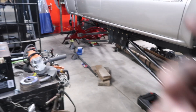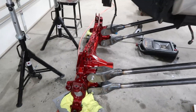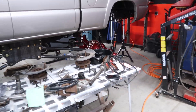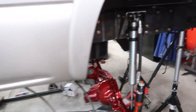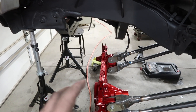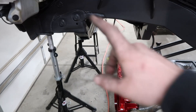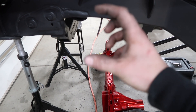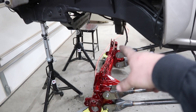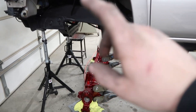We might need to order some stuff, but we have both axles under the truck, bolted on — not fully, but we're going to jack this up now and get it set, centered on both of them, so we can take proper measurements. I still have to make a crossmember that comes across here. The reason we need to get the front in is because we need to know our steering before we can set the rest of it to eliminate bump steer. Basically we're going to make our drag link from our pitman arm to our knuckle, and once we find the length and degree of that bar, we can then make our panhard bar to match. You don't need to do it for the rear, but I'm trying to make it all look perfect. Once we have our front panhard bar made, we'll make the one for the back, and then the truck should be able to sit on its own weight.